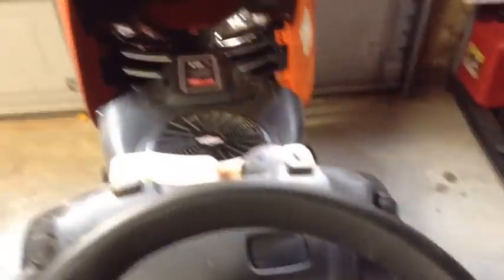I'm going to take the spark plug wire off because I don't want my mower to start. This one is an Ariens/Husqvarna/Craftsman — some other mowers too. They have the battery here and a solenoid up here. So with the blade turned off, seat switch activated, and brake all the way on, you can see now it works. That's basic troubleshooting in case it was just working a minute ago or you forgot to turn one of those off.